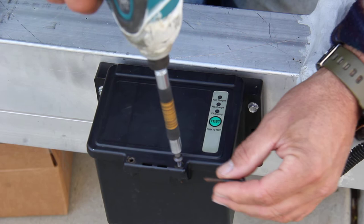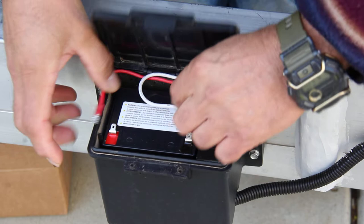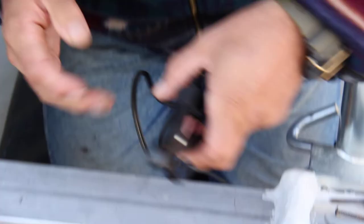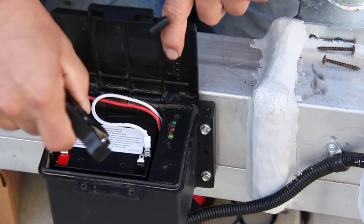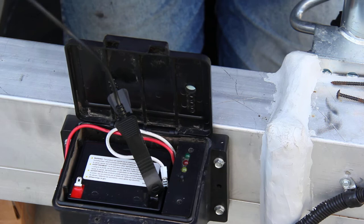So when you don't use your trailer for a longer period of time, here are two things I'd like you guys to know. First, take these two wires and disconnect them — you just pull them out, they come out really easy. Then get yourself a battery maintainer from Harbor Freight. It's a charger and a maintainer, and you can leave it hooked on like this. They fit really neatly because the clips are kind of hooky so they go right underneath the pins.